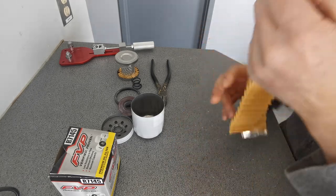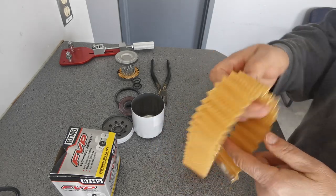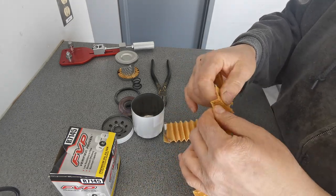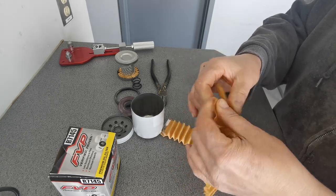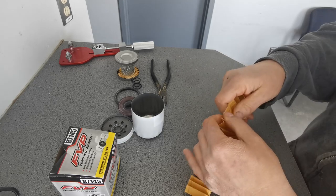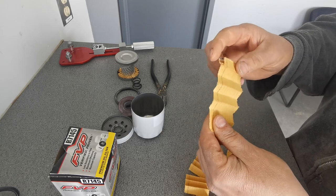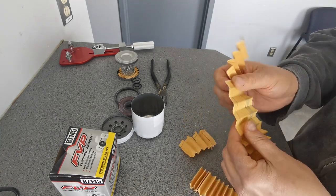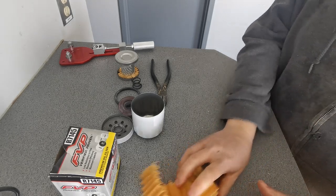It's pretty light — I'm holding almost nothing at all in my hand. This is so light, no weight to it whatsoever. This is the easiest stuff I think I've been able to rip. This is not very good filtration — maybe it is, but it's very thin, so there's probably really quick flow through it and it'll stop bigger particles like most oil filters. But after this gets wet for a while, this thing may just destroy itself. If you want to use this filter, you can, but me — I personally would not.